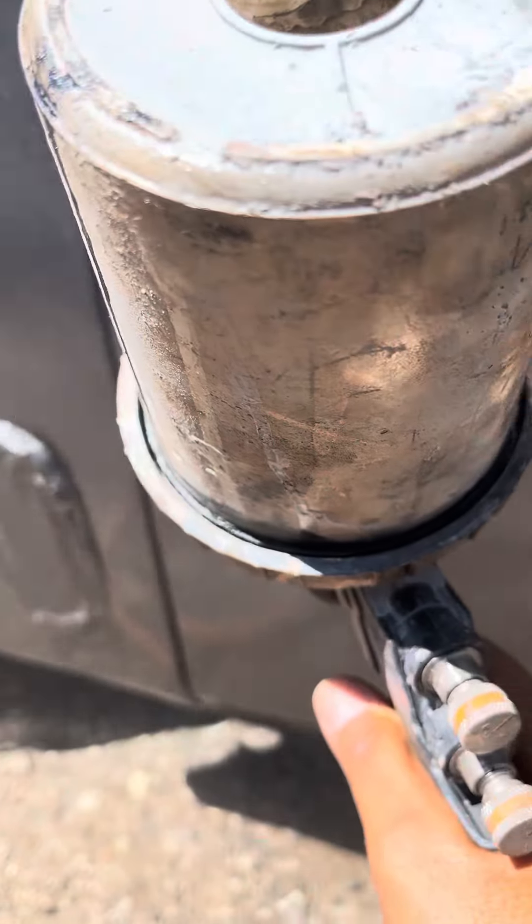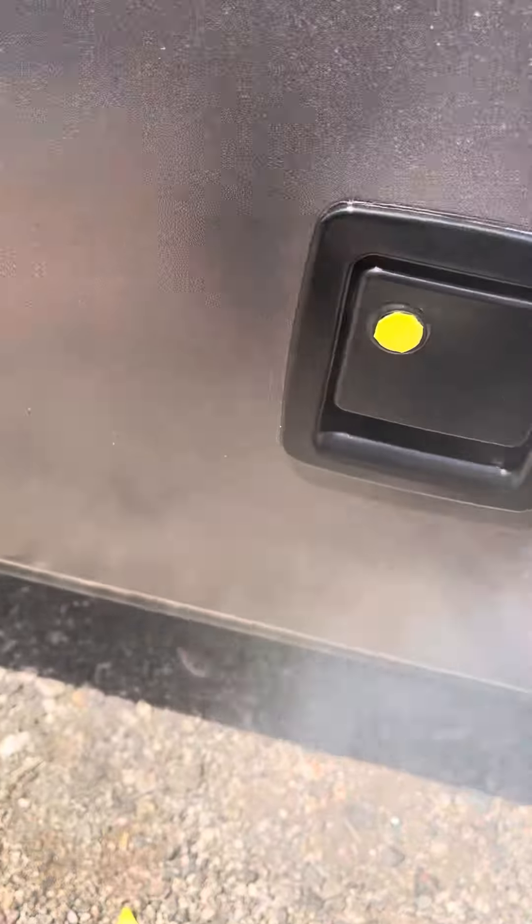Now I've got my high glamour coat solid, very little reduced. The only reason it's reduced is to come out of the gun, because at 100% it's very thick, the atomization is too high, and it doesn't leave it very shiny. So here's my gloss coat coming on — and you'll see how the reflection is looking beautiful.